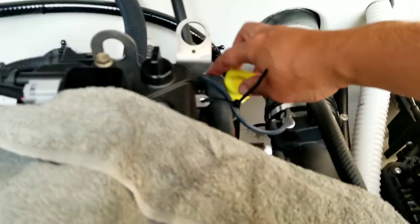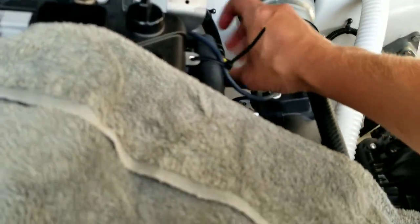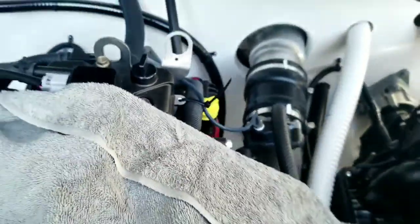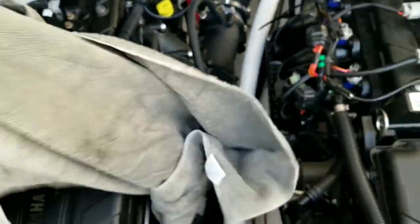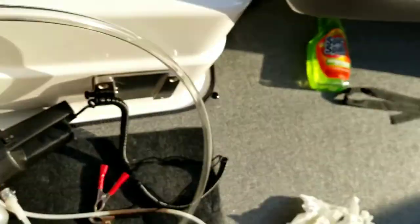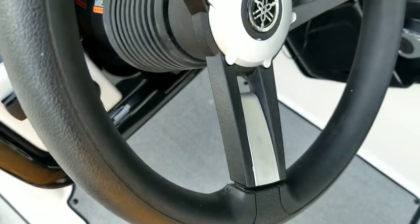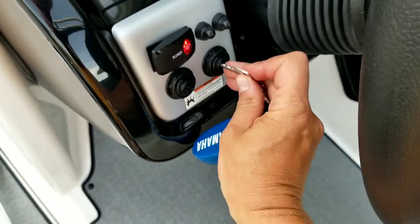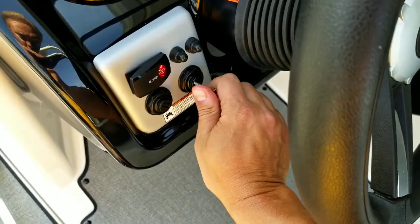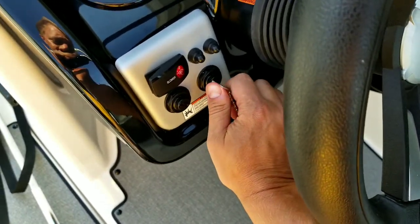We're going to start up the engine, make sure that you, of course, put your dipstick back in. We're going to run it for 5 to 10 minutes, then we'll let it sit for 5 minutes. To start the engine, make sure that you've already got your water line hooked up, and run the blower, that's a good habit. Then we're going to start it up, and I'm going to then go back and immediately turn on the water. So we're going to start the starboard engine.